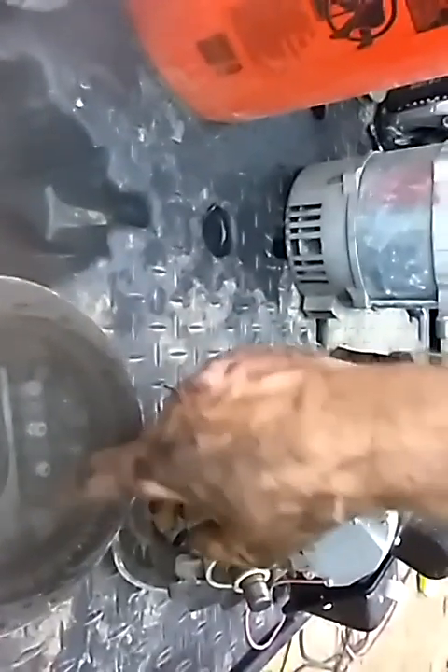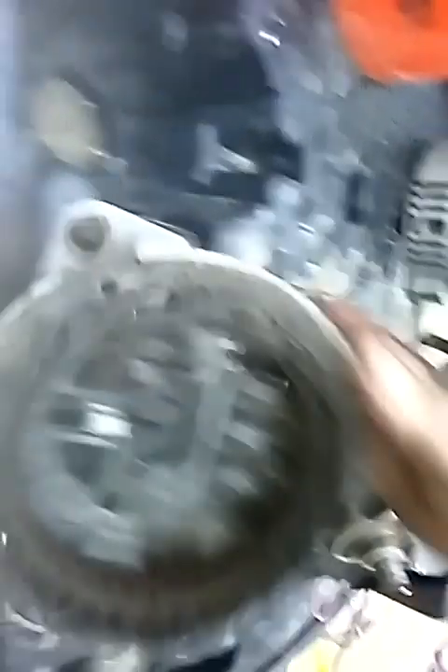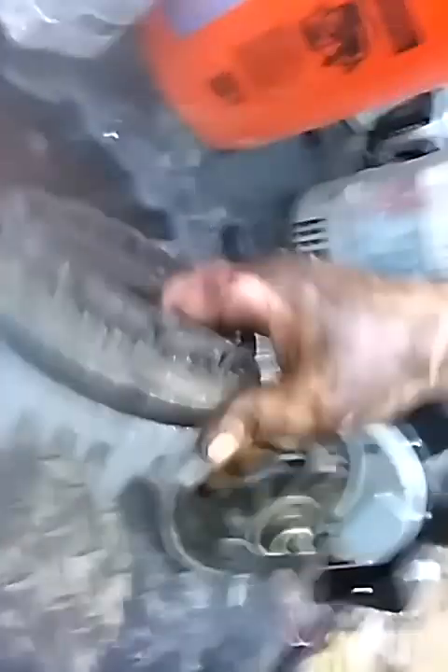The steel in these coils will absorb and transfer the charge into the stator coils — there are three coils, three wraps here, three wraps here. You've got three coil wires. It's pretty simple, pretty basic. I mean, it'd probably come right out if I give it a little work — and yeah, there it went. That's it right there.